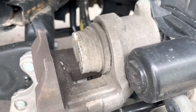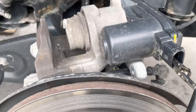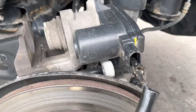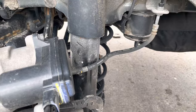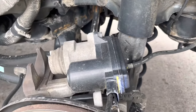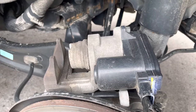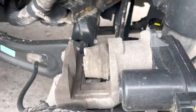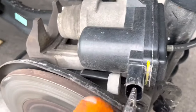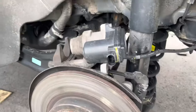See how it didn't move at all — that's a good thing. If it starts moving outwards, you have to reverse your clips. If it's not moving at all and you just hear the motor going, that's a good thing. We're going to hold that until the caliper starts moving — there we go. It was going outwards, so I need to flip the clips.